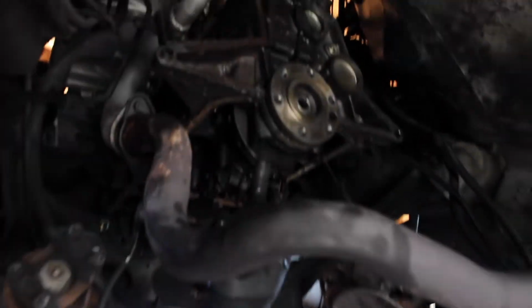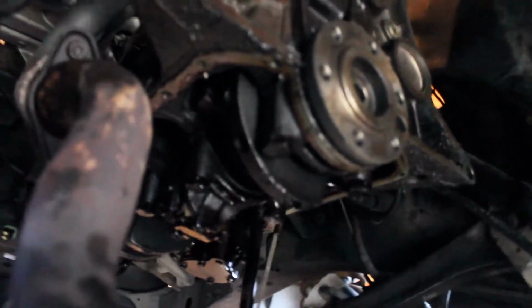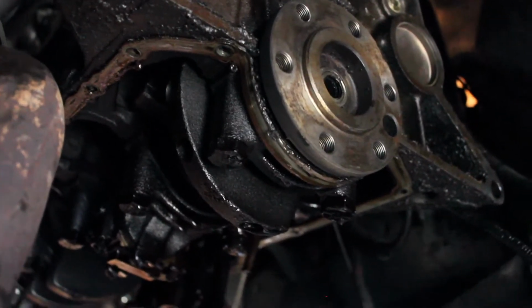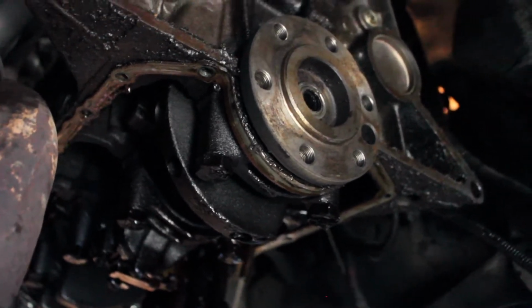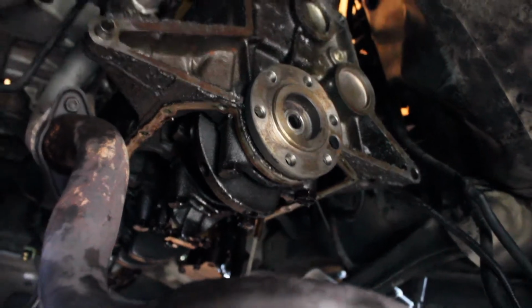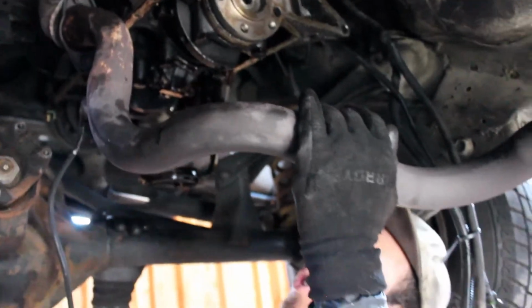Okay, we're up under here. You're going to need to get the camera angle. It's these two bolts. Here's the last bearing cap. These need to come out. I don't know what they are, probably 18 or 19 millimeter. I'm sure it'll work. We're going to take that out. Be very careful with it. Don't drop it, you can break or crack it. Be careful not to touch the bearing. The underside, I'll show you that, and then I'll show you how to get the rear main seal out.